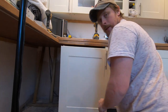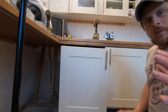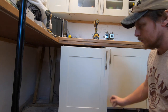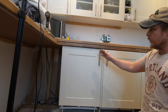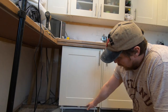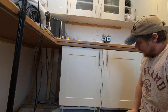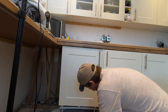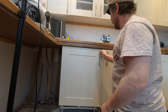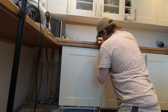When you're happy with the position and you've tested it, put a few more screws in. Push it all the way back in now and get it all positioned correctly before we do the final fix of the door. Once the freezer is at the correct height front and back - as you can see I've had to put a bit of wood under the front and back because the legs weren't long enough - as long as you keep it level, bring this forward so it's in line.